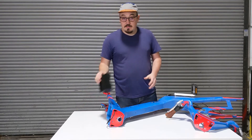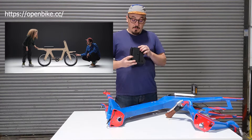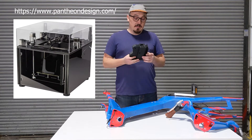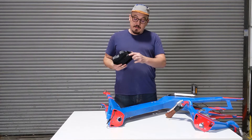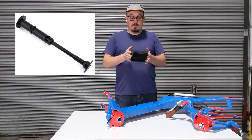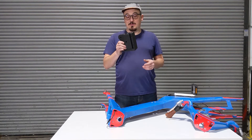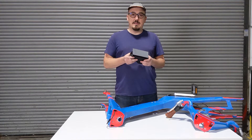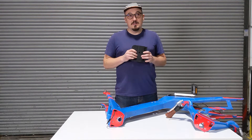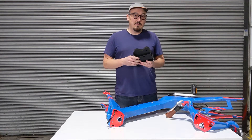Another design that I'm looking at that's really different is this OpenBike project. This is a 3D printed part from openbike.cc, and Pantheon Design Works in Vancouver, BC printed this for me. What you do is you put the bearing in here and the headset in here. And then there's what's called a stem lock that holds it all in position. We'll get to that in a future video. It's a non-traditional headset design that I'm really fascinated by, and I'm really curious how it could be accomplished. So let's try to do that with this project and see what we can come up with for bearing surfaces.